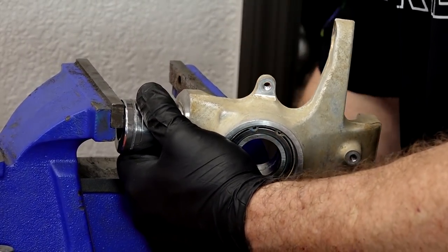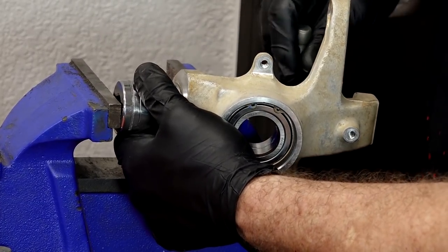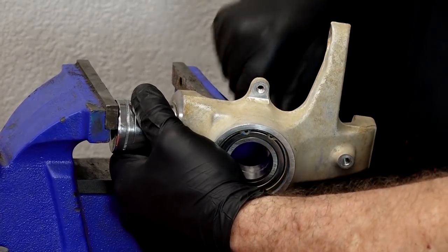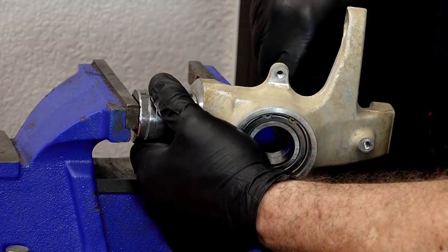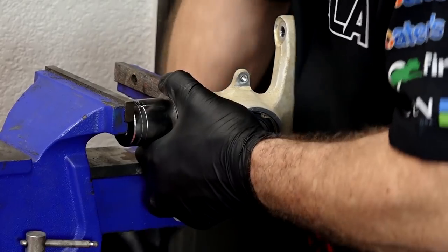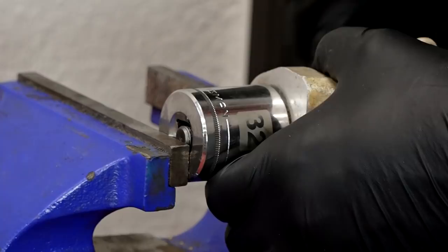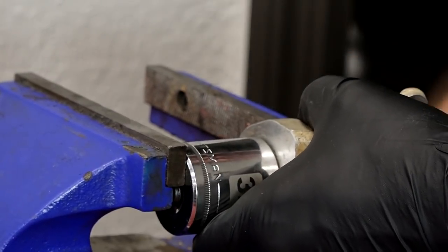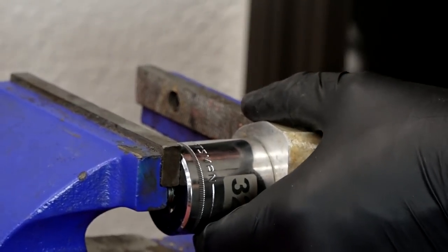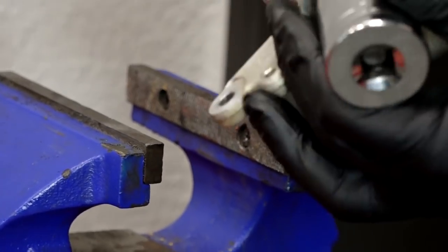Make sure you're square going in. I'm just kind of moving it around the outside edge, back and forth, to make sure I'm centered — kind of trying to wiggle it in there. Not the easiest way, it's the only way I can come up with without having to buy that Yamaha special tool. And what are the indicators that you need to replace a ball joint? Well, if there's a cut in one of the boots, yes, you need to go ahead and replace it. If you jack up the machine and you try to rock it back and forth and it's actually clicking on the inside of the control arms, well that's your second indicator that that joint is worn out.